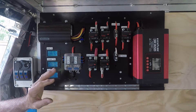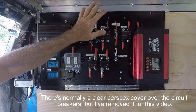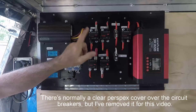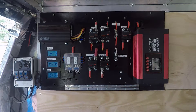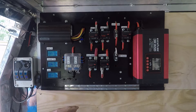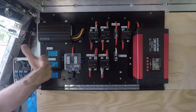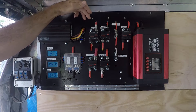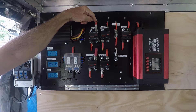Let's start with the circuit breakers. I used resettable circuit breakers — the manual reset ones. The idea being: if something happens and a circuit breaker trips, I don't want it to automatically reset. I need to know where the fault is and which circuit it's on. It might seem like overkill, but for me this system works and I'm quite comfortable with it.